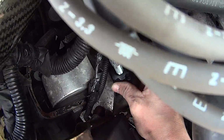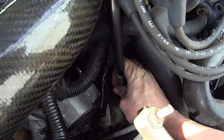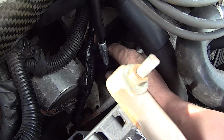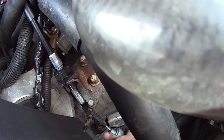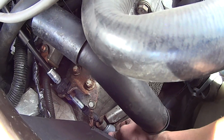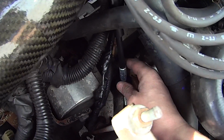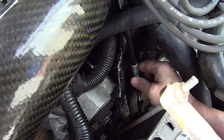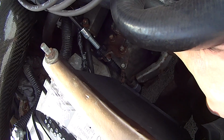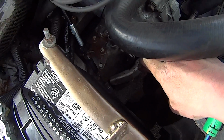So now we're gonna orient this rubber thing so it goes down into the bracket, which is being a pain. Okay, so now that hooks into there. This is finally sitting down. Now we just need to tighten it up until we have some tension and test the clutch. There, try it now. Tell me when it moves. Slightly, yep. See what it feels like.